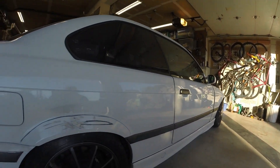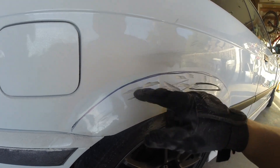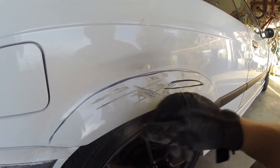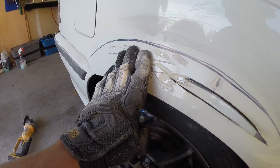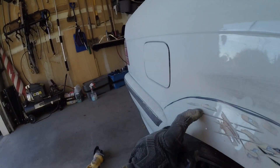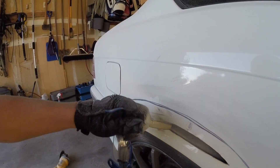So I'm cutting this up and look at all this stuff - see how there's no metal in there? This is all bondo. This whole panel right here is all bondoed. I was cutting this to expose the metal and get to the second piece of metal behind. And right here it looks like somewhere in here it had a pretty good hit at some point in its life. Doesn't really matter now - the car is straight - but that's a little concerning. Look at all that bondo in there. Wasn't fixed right. Some shop did a crappy fix at some point.